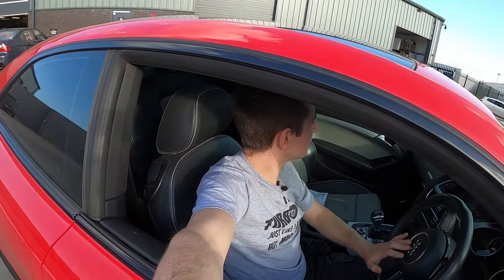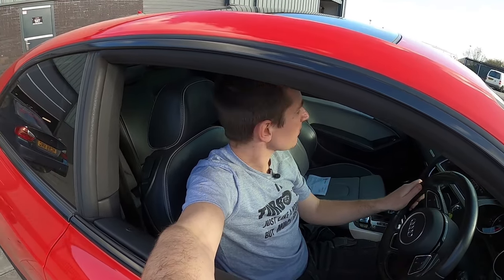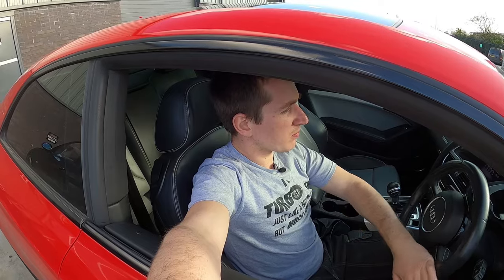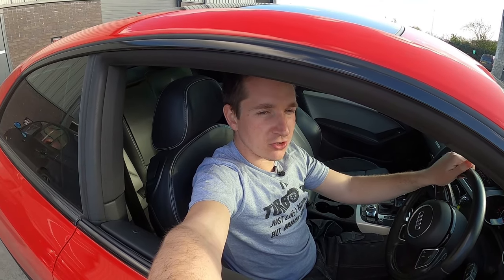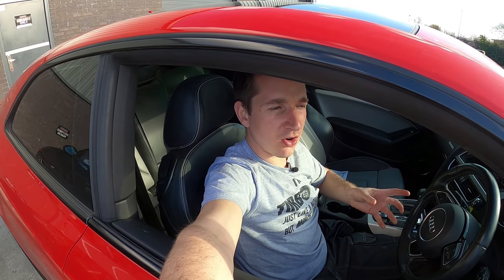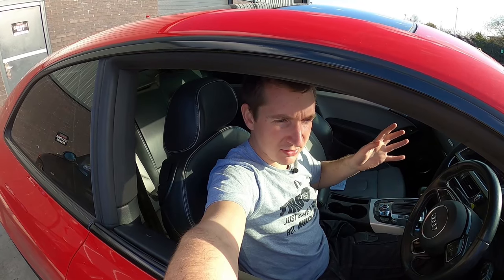What we've had to do after this is put it onto VAGCOM, let the engine warm up, let the gearbox warm up a little bit. It's miles better. You can just let the brake off in reverse. Basically now you have to do the clutches, and then so the gearbox knows where the biting points are, you have to do a basic setting which has to happen at a certain oil temperature and a few other certain circumstances. You just sit there and it grabs between every clutch - you can feel them all moving and grabbing. Then you go for a drive and it drives tons better.